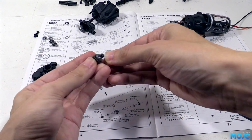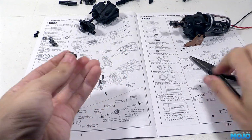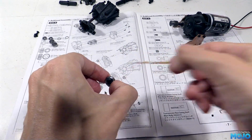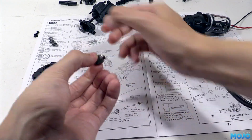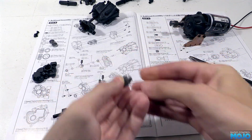Install the last of the gears, a 20 tooth, and clip a large E-clip in the slot. Now all we do is add a little bit of grease to the E-clip and slide on a shim and a 5x8x2.5 bearing. Flip it over, apply some more grease to the back of the gear and slide on the last shim and the last 5x8x2.5 bearing.